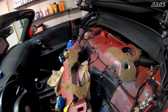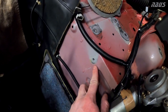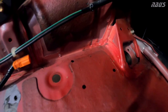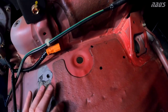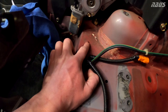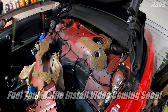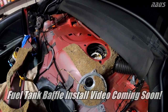To give you guys a look at where the holes are that I marked when the roll bar is in there — there's the three right there, and that's where the bar slot was through. Three sharpie marks there, and then three back there right in front of the grommet, and the ABS hole sensor is right in front of that. Over on the passenger side, you've got the three on that flat surface there. The only tricky one is that one — the center of the hole is up on this raised piece, probably a strengthening plate, so it's going to be kind of tricky to drill. Then the other three: one there, two, and three right there. And in front there is the hole the slot is lined with. If you're going to do anything with the fuel sending unit, like putting in the baffle plate like I'm doing, I suggest you do it now before the roll bar is in, because you have a lot more space.